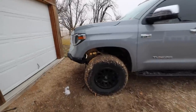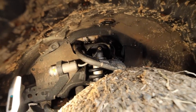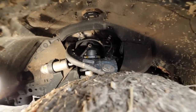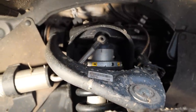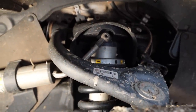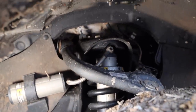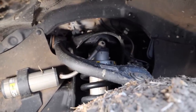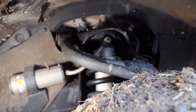The BP51 kit comes with a front coilover. They're all adjustable for rebound and compression right on the actual shock body. It's very adjustable on the top — you have that preload that you can do to adjust the ride height and be able to clear your tire and everything like that. I've had no issues whatsoever with the front shock at all the entire life of one year of really running a lot of trails and frankly quite a bit of abuse. It's performed flawlessly, no issues there.